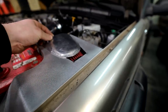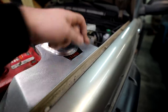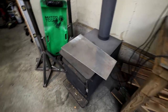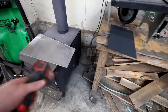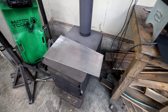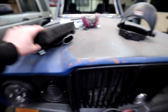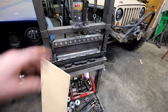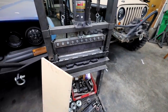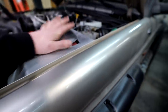I decided to use that piece I was forming as a template to mold the Kydex to the shape we want. I'm going to cut a piece of MDF plywood to fit underneath it, heat up the Kydex on my wood stove — I just put a clean piece of aluminum on top of the stove, and once it reaches about 275–300 degrees I'm going to throw the Kydex on there. We are at 154 right now, so it's still climbing. Once it reaches the correct temperature I'm going to put it in a Kydex press — the top part will be foam and the bottom part MDF — and I think I'll use my actual press to deliver the clamping force we need. After about 20 minutes of letting it cool in the press, we can undo it and bolt it all together. A lot of this is experimental, but I think it's going to be the best way to get the contour we want without having to polish up a metal piece.